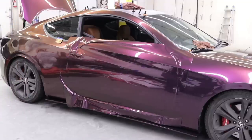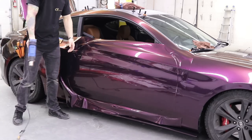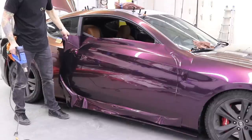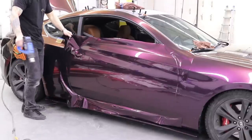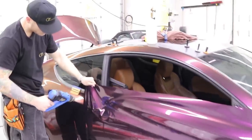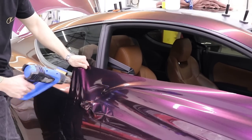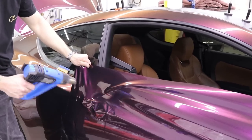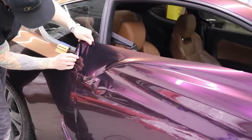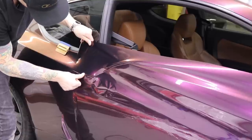I'm going to grab the heat gun, which I didn't switch out yet for my Vvivid one. This one's dying. The cord has been taped together, so I didn't even want to fuss around with it. So I'm just going to add a bit of heat right here and get this slightly flattened out. Again, very gentle with the heat. You can see that I'm not even moving my hands. So I'm just going to place the vinyl down. It needs to cool slightly, which it probably has already.